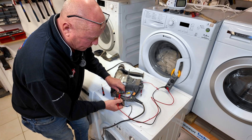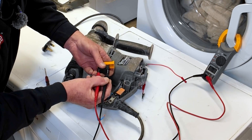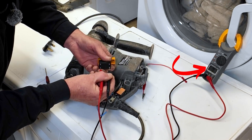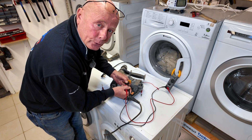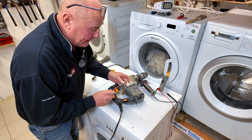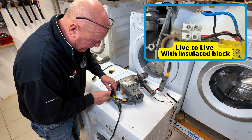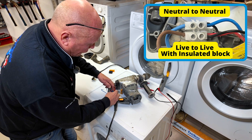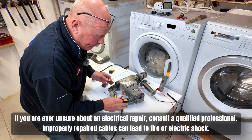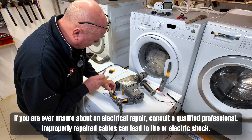Trying this on the live side - that is what led me to the problem with this drill. This basically means that the switching system inside has failed. And if I get the new switch to show you and go across the live side pressing the trigger, we can see that we have continuity. Going across the neutral side, again we have continuity. Now I'm going to quickly show you how to test the drill using a connector block - joining the neutral in and neutral out together, and also the live in and out - which allows me to use the switch on the wall as the on-off switch. This should only ever be done by people who are competent with electrics, but it lets you verify the drill is in good condition apart from the switch.